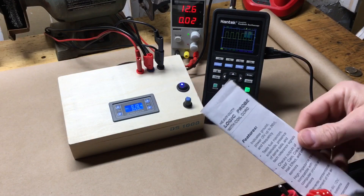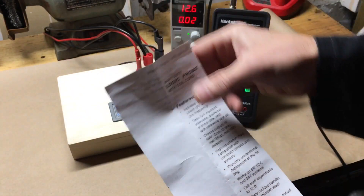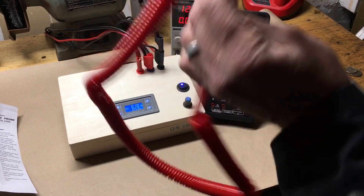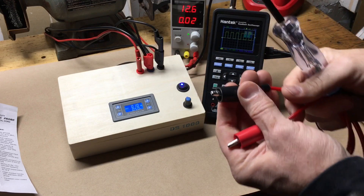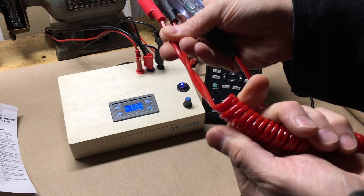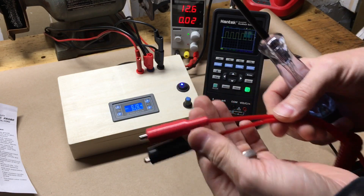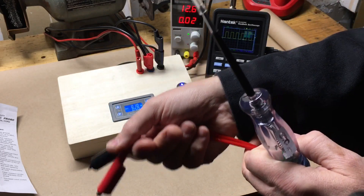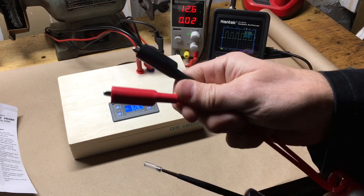I wanted a dual polarity test light. According to the instructions, it works between 3 and 26 volts, so it's good on 12 and 24 volt vehicles. It's got a curly cord — claims to be a fairly lengthy lead which is nice. Looking at it: kind of plasticky wiring, chintzy little alligator clips. I could cut those off and put on some 4mm banana plugs, and then I could also use this with my breakout box using the power and ground on pins 16 and 5.